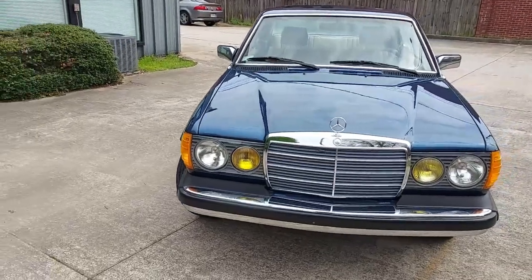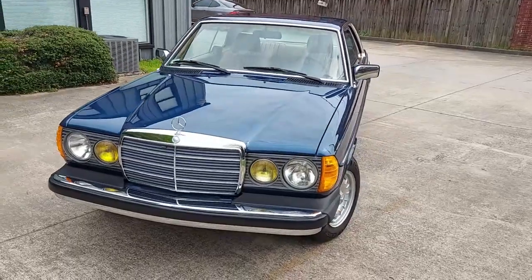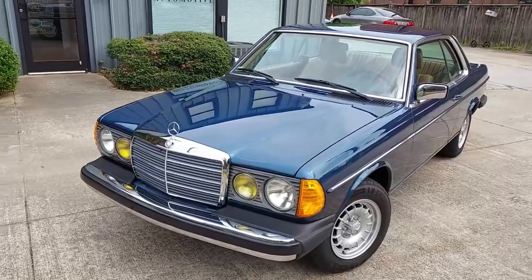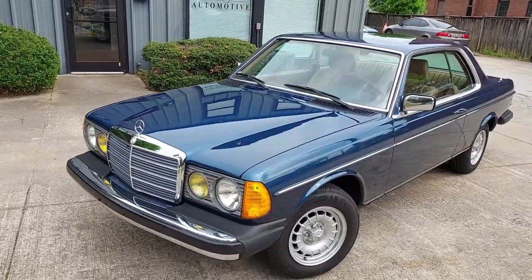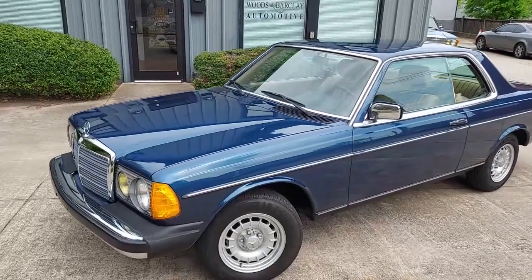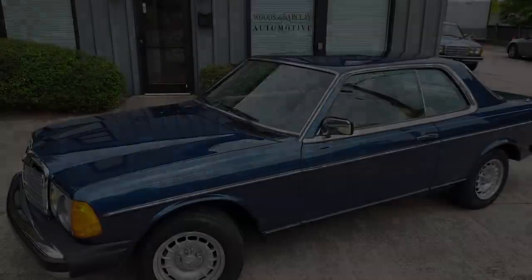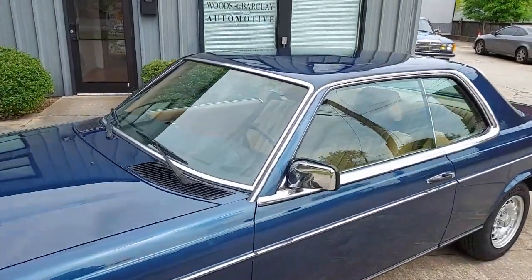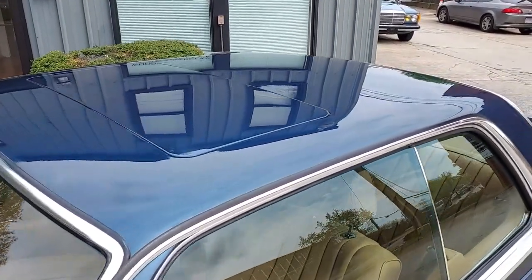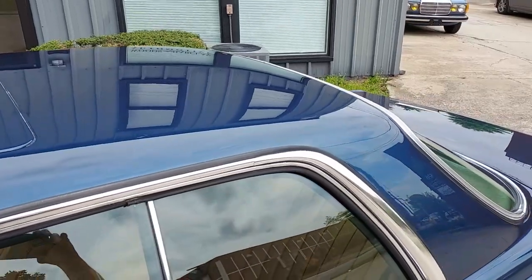New shifter bushings, lubricated power window regulators, did a valve adjustment, new valve cover gasket, lubricated throttle linkage, oil and filter change, power steering fluid and filter, brake fluid flushed, differential service, new main fuel filter, new pre-fuel filter, new fuel primer pump, coolant flush, lubricated the Hirschman antenna, retightened the seat back nets, installed a new hood pad, new air filter, serviced and recharged the AC.